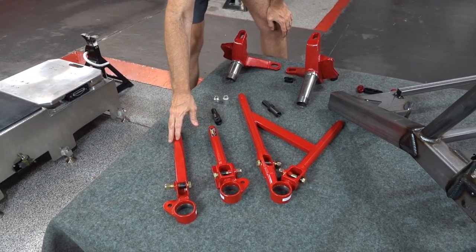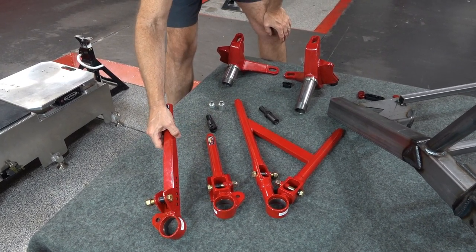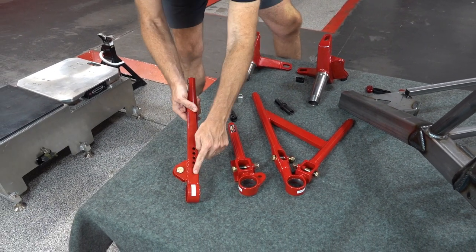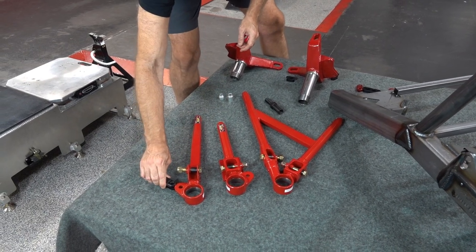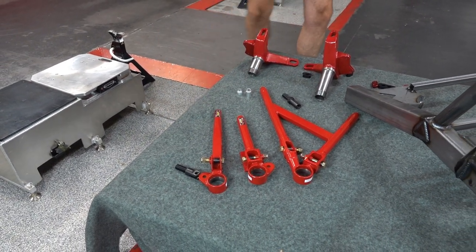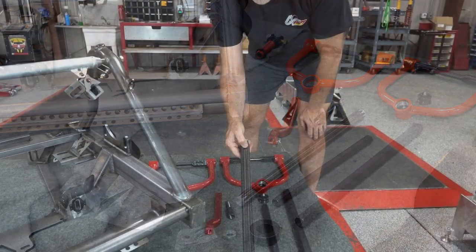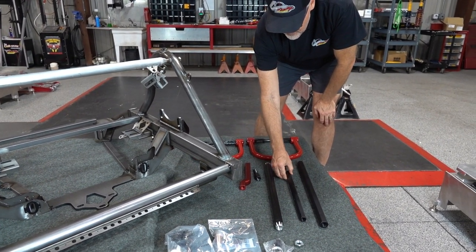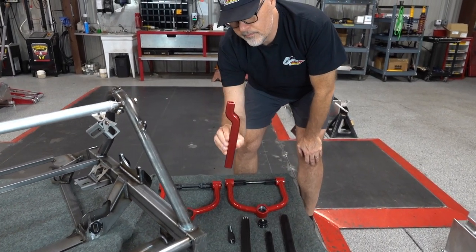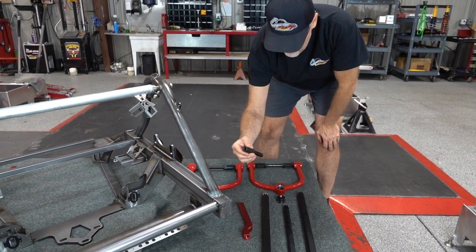If you run a two-piece lower control arm, this is your left side with a drop shock mount — the right side we don't normally do the drop mount on. There are many sway bar variation mounting points, and this clevis will bolt to that for your struts. Strut-wise, you have your choice of either your traditional hex tubes or the popular scallop tubes if you're running the two-piece lower control arm. This is your right side tie rod sleeve. The left side uses a drop tie rod so it doesn't hit the bottom of the frame rail in travel — there's also an adjuster for that included with the kit.